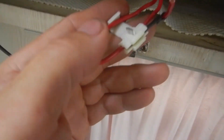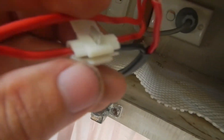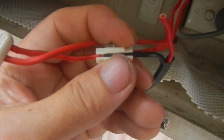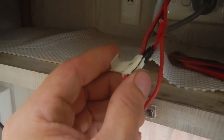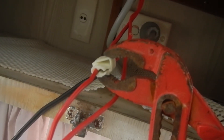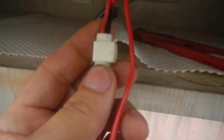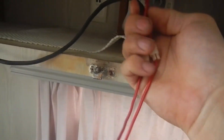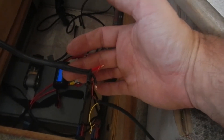These are our wire taps. You've got a metal piece that you crimp or squeeze down, and that'll compress into the wires and make a connection. You put your feed line in one side, and then the other wire you want to connect just goes in the other side. Press it down, and once that's been pressed down, you'll find that metal piece goes all the way through, cutting into both wires. It's just going to need a pair of pliers. And you'll see that's a nice, solid and clean connection. That's both connections on — that's going to be a nice little feed. We'll cable tie that together to tidy it up a bit. Just a quick test to make sure we're actually getting 12-volt at the other end.